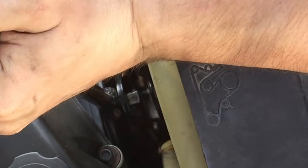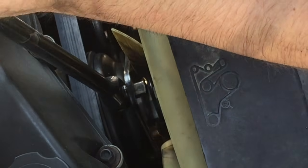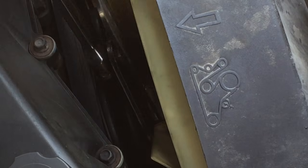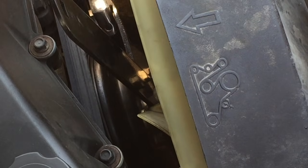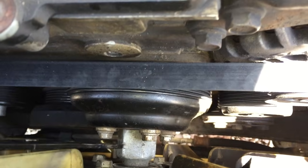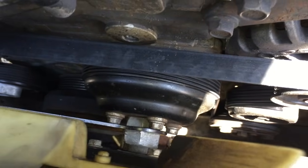Here goes nothing. I ain't going to lie — the other one came off a whole lot easier than this. That bad boy is on there. You can see here I finally got the nut loose — it'll spin without rotating the pulley for the water pump. Now I'm going to take this nut off and push this fan back a little bit. With everything disconnected on the fan shroud, I should be able to lift this out. I've got to be careful with these lines here.